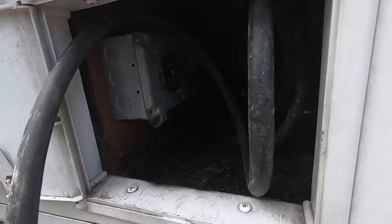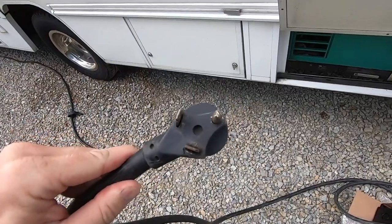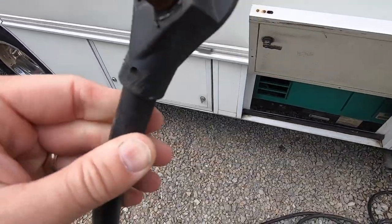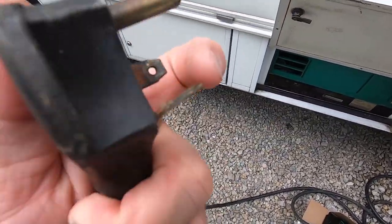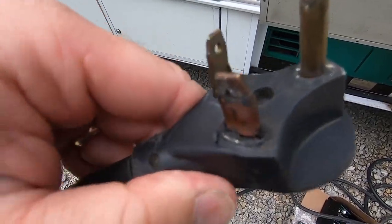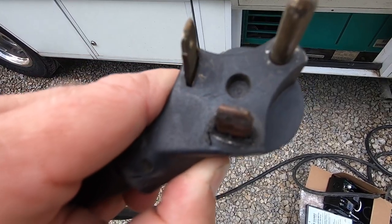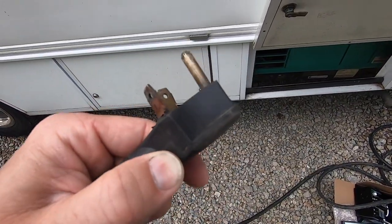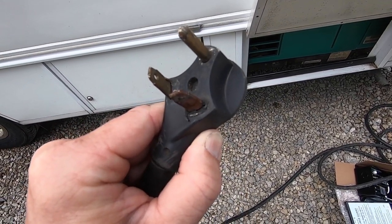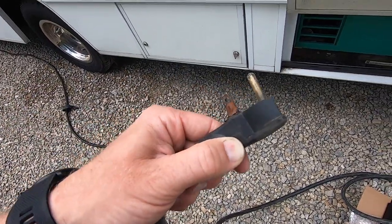There are two separate electrical boxes in here, and this seems like a pretty good spot. At the same time I'm going to go ahead and replace my shore power cord. Something to keep an eye on: if you look closely you can see they're starting to melt around the terminal on the shore power cord. When you use these a lot over time, the terminals become loose — if you can wobble them with your finger, they've worked themselves loose and start to break away from the wire inside the cord head. Less wire, less contact means higher resistance; resistance causes heat, and heat could cause a fire. It actually just blew the circuit breaker yesterday because it overheated, so I'm going to replace this cord at the same time.